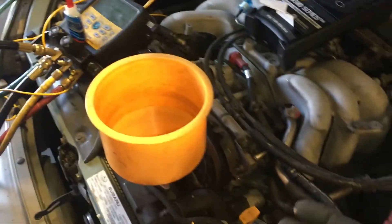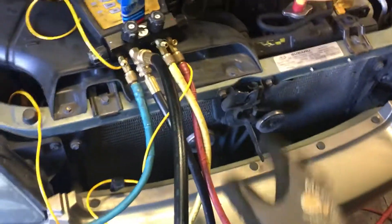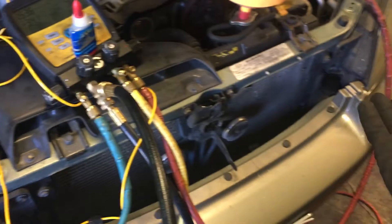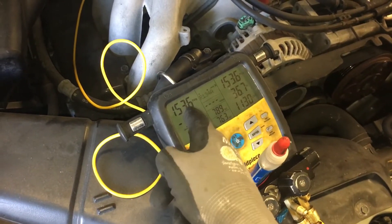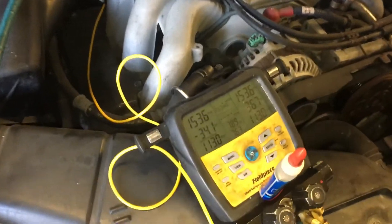You just don't stop the job and sell those parts right now — we don't know if the compressor is damaged yet. We haven't run the system; it only came in with 31 psi. We don't know if the expansion valve is frozen or plugged, if the desiccant material came apart and plugged it, or if there's a leak on the condenser. It came in non-operating — possibly for over a year — and any oil stains could have been washed away by rain. My nitrogen has been holding rock steady at 153 psi without moving even a tenth.